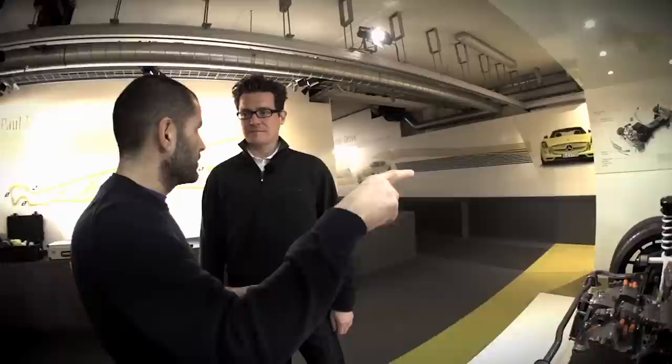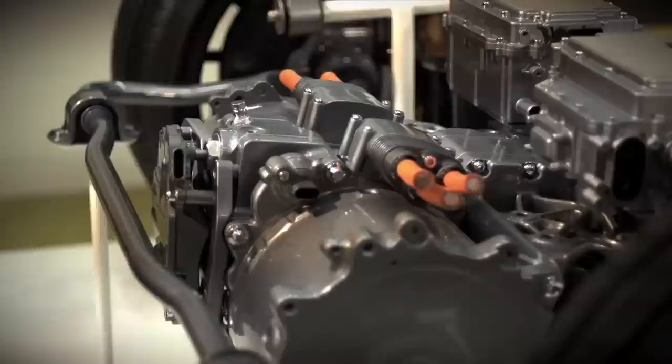Okay. First of all, four electric motors, yeah? Four electric motors, one in each wheel. Torque split 25% per corner. That's the basic setup, yes. But it can change, and will change if you're driving in a dynamic way. Torque vectoring will help you set the right torque on the right wheel in the right second.